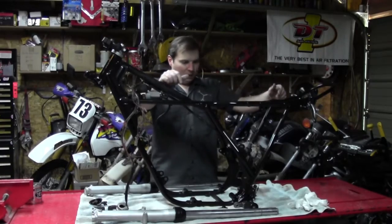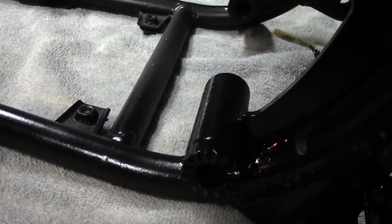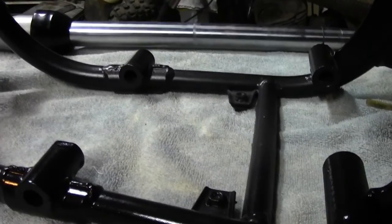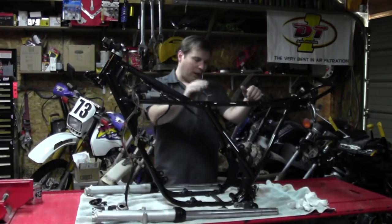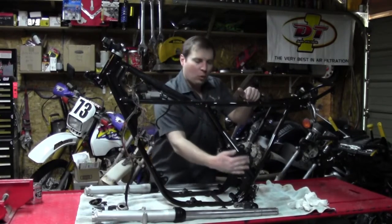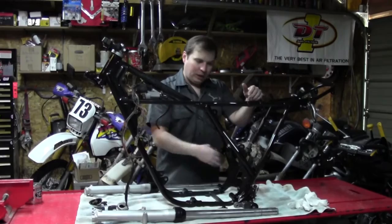That's what I did here, and then I cleared it with a urethane clear, automotive grade — put four coats on this thing. So it's got a real tough finish on here. And like I said, given this is just a show bike, where your boot wears here — I'm not going to be riding it, it's not going to be a daily driver — this is going to wear just as long as the factory coat did.